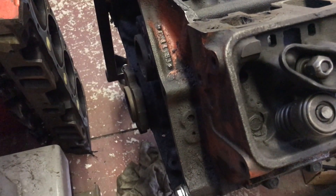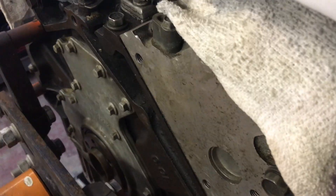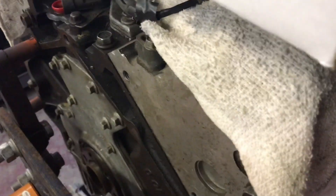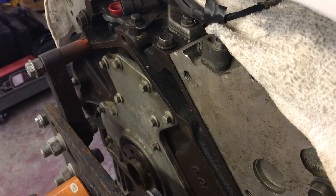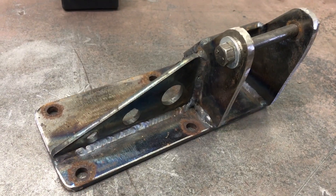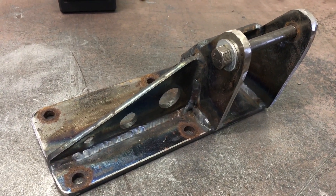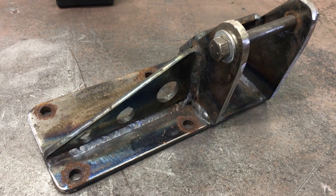This is the back of the engine cylinder head area of a 350 Chevy traditional engine. That inch-and-a-half shelf right there is not present on the LS motor — the cylinder head is flush with the bell housing. That is why the off-the-shelf mounts don't fit. If you put an LS engine in the same spot that the traditional Chevy engine was in, the cylinder head is rubbing on the firewall. The adjustable ones let you move the engine ahead half to three quarters of an inch, but it's still not a great fit. A piece of four-inch flat bar and a little bit of imagination makes a pretty nice mount.